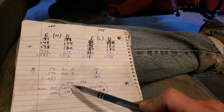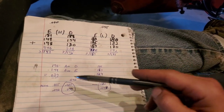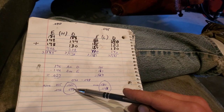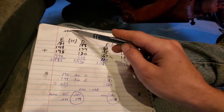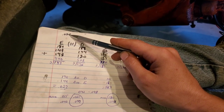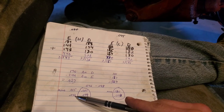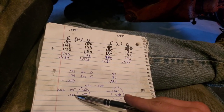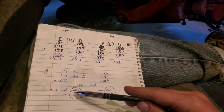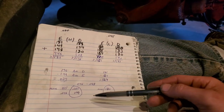These numbers are supposed to be 42 thousandths and 48 thousandths to be within spec. So what I'd like to do on the high clutch is move 20 — that brings me to 47, very nice. However, if I move 20, I'm going to be down below 55 on my overall shim pack. So I'm going to have to move 15 instead, which means this will be the last leg for this clutch before it needs to be rebuilt.